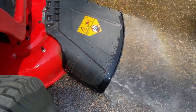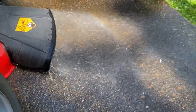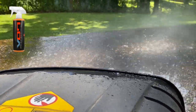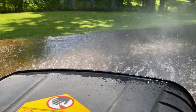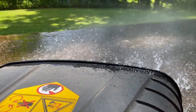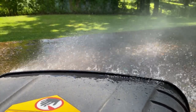Those are my two cleaning steps after each and every mow. There is one last thing I do about every third cut: I wipe down the mower with Chemical Guys V7 Hybrid Cleaner — not advertising for it, it's just a good cleaner. I wipe down the metal and all the plastic surfaces. It gives good UV protection. I even clean the engine shroud with it. That's how I keep my T210 looking as new as possible.